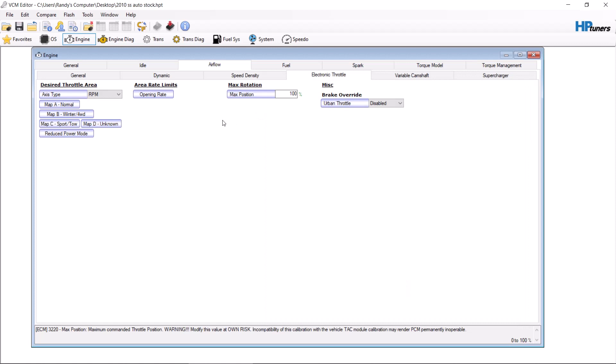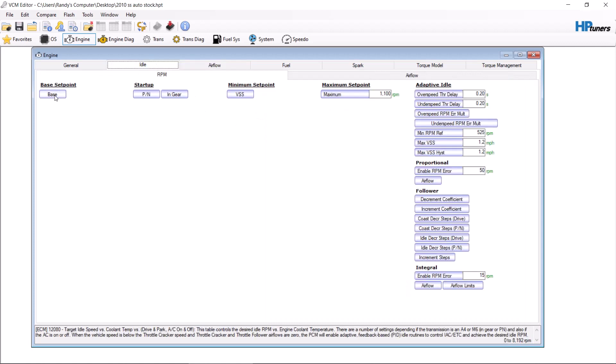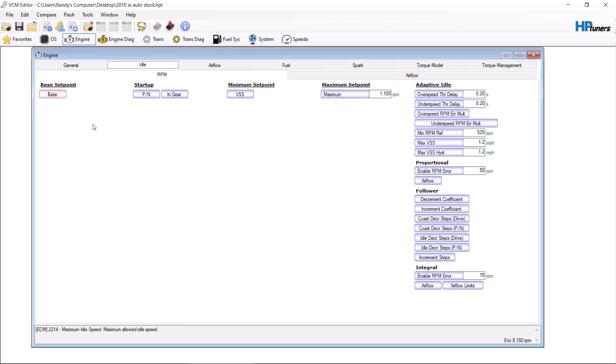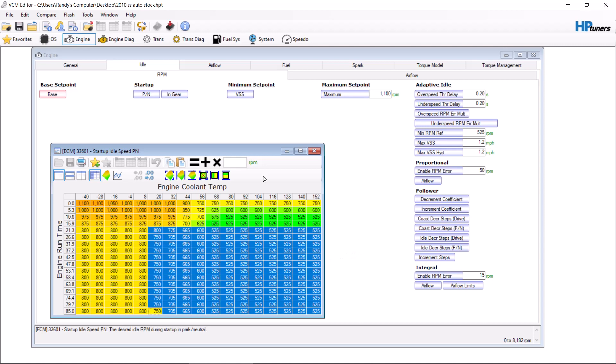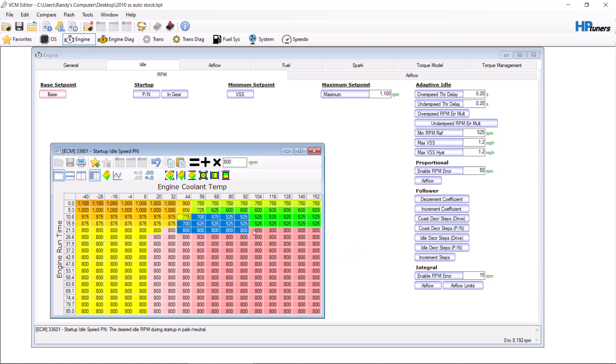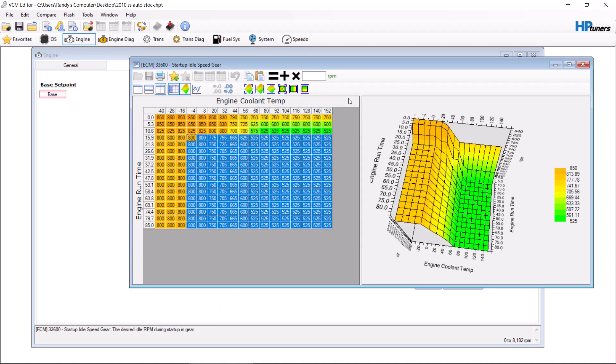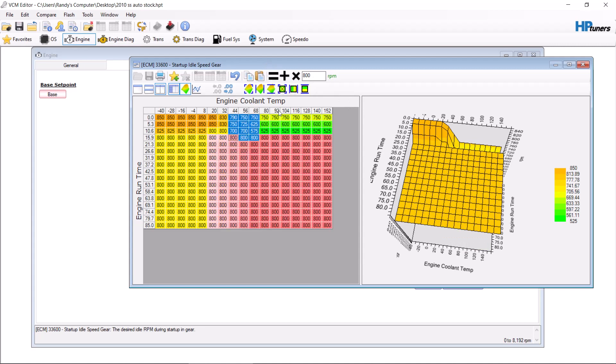I've done multiple videos on how to tune your car after a cam. We'll make an exact video on just how to get your car to idle properly. One of the initial things you want to do is set an idle. A lot of people go out and put their idle at 900 to 1,000 — a little excessive. Your idle should be as low as possible without it dying, but not so low that the car bogs. For most vehicles with a cam, 800 RPMs is the best starting point. You can work up or down from there depending on the sound you want.